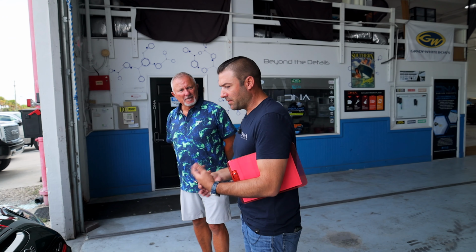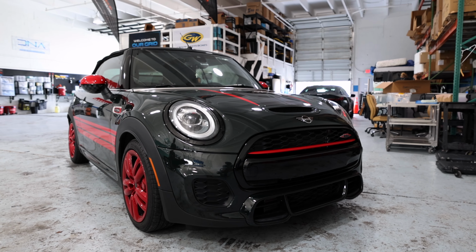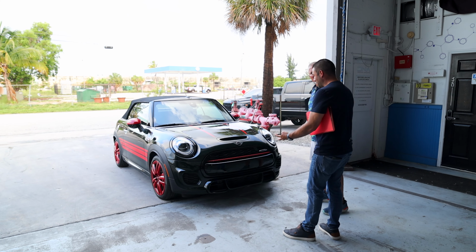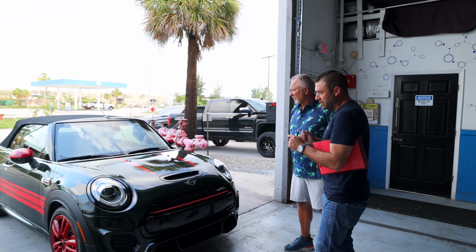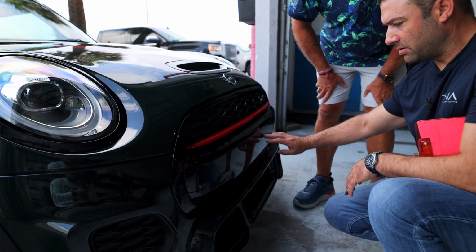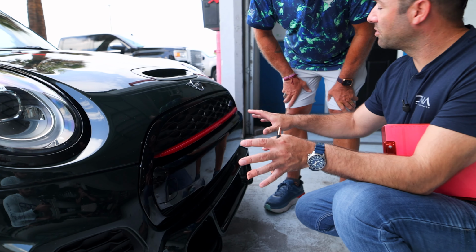So when we talk about PPF, really the goal is to get you what you need. Now I think a car that's low to the ground, you should be doing the whole front end, because if you see this thing backed up to a regular pickup, the bumper is here, right? Yeah. So you're driving down the road, you're going to be catching a lot of that debris, whether it's sand, rocks, it doesn't matter what it is, you're going to catch it. One thing you need to know is you can actually do PPF on all this little trim. So these little pieces here, you can go across all the nose pieces and anything like air dams and things like that. It's pretty comprehensive what they can do, especially now with the computer cut. They can cover everything really well.